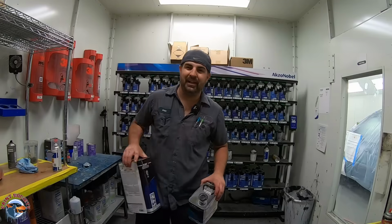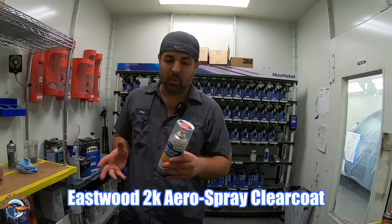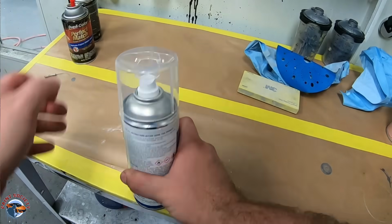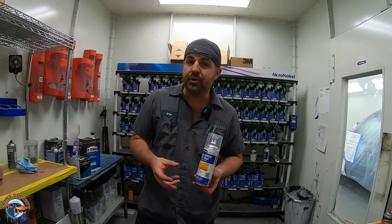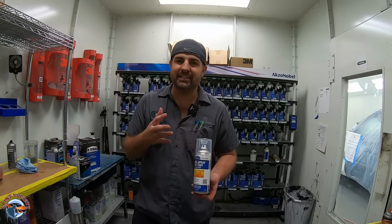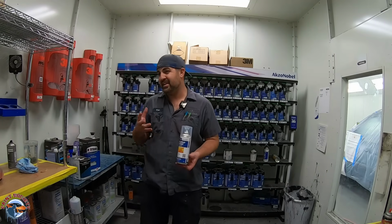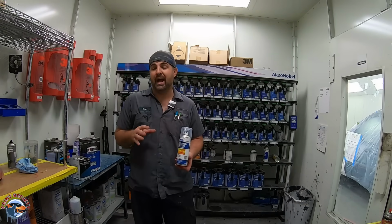For regular paint, you've got your hardener and you've got your clear coat. So in here, how it works is the top comes off, it goes underneath, and then all you're going to do is pop it against the surface of something hard, and that's going to release the hardener into the rest of the can. And from here, it's kind of like a ticking time bomb. Now, some people say you get 2 or 3 days, but if you keep it in the cabinet, you can get up to about 7 days. But most likely, we're going to use this whole can on the actual car.